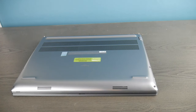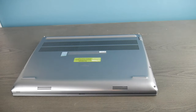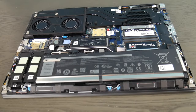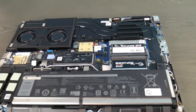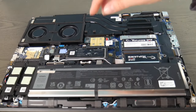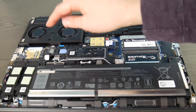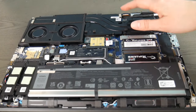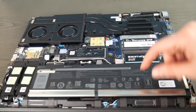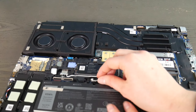Once inside, I'm going to do what's called releasing the flea power in the computer. I located the battery because what can happen is you can have a buildup of residual power in some of the components — the motherboard, the RAM, things like that — and it can cause issues like a black screen. It can actually cause a lot of issues, so if you ever have a hardware problem, this is the first step to try.